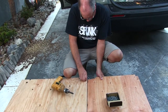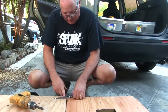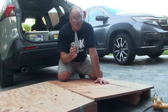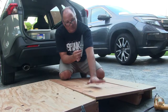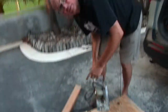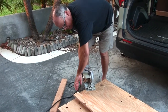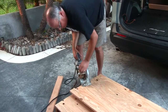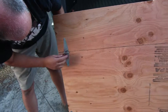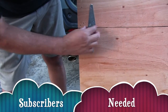It's really super important that we get this flush and that the hinge isn't at an angle to the board, because the two hinge lines have to line up. We chose this style because it was the narrowest one we could get, so if you're sleeping on this you're less likely to have it in your back. Fit check — we just did the fit check inside the car and found a little problem. This corner, because the inside of the ceiling is curved, this corner and the corner over there is hitting. So we're just going to take a little bit off. The hole was right where we wanted to put the hinge, so if you're doing this I recommend you move the hole in more and move the hinge more to the outside.